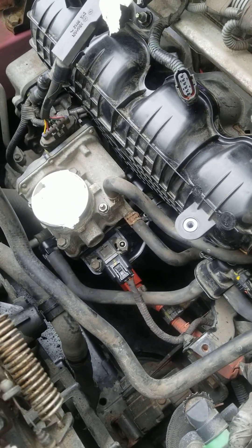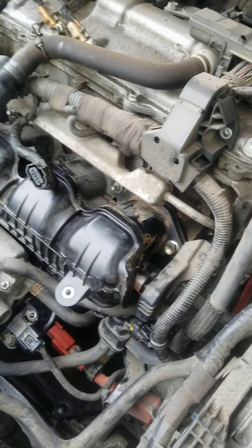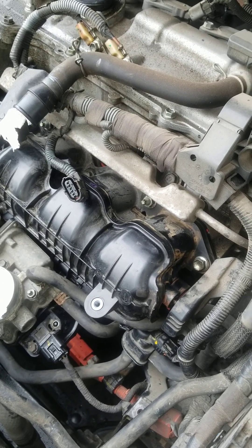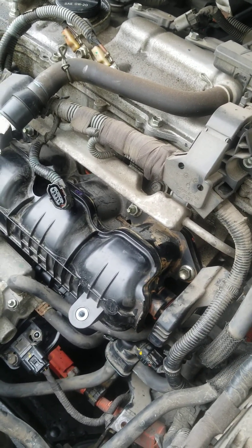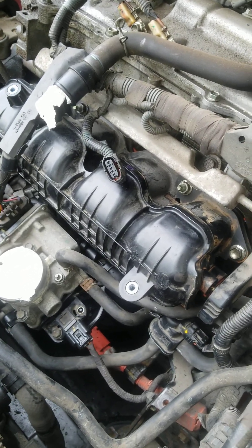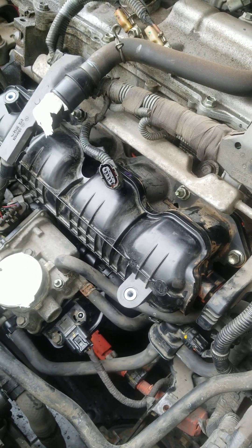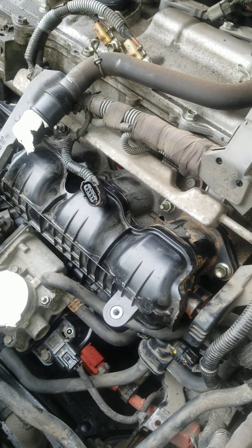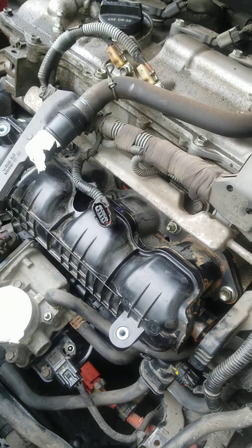There wasn't as much oil down there - I mean there's oil down there definitely, there's definitely a cruddy sludge. So maybe it was more likely that there's just so much of that sludgy soot that would more readily evenly distribute in the cylinder, going in through the intake and valves and into the cylinder, and combust more effectively. Instead, I'm guessing - I'll throw it out there, make sure to comment below - that oil-laden soot turned to sludge, plus some pretty hard flaky carbon deposits going through the cylinders, and poof, not good.